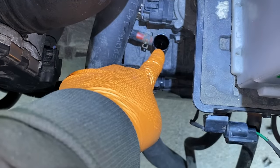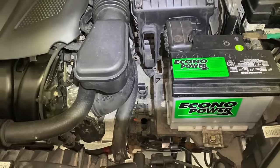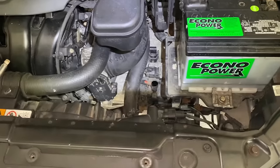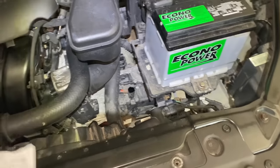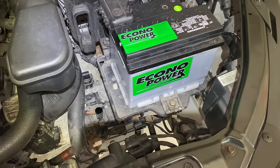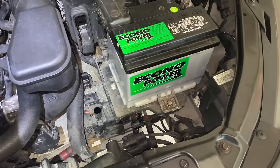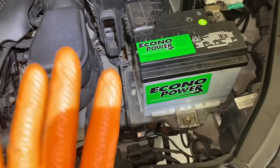You want to get that O-ring before you start this project. Now we're going to put a funnel in here and add the exact amount of transmission fluid we took out — that's the perfect starting point, especially if it was never touched from the factory. Note that your particular transmission may require different fluid. This car — a 2015 Kia Optima — requires Kia Automatic Transmission Fluid SP4. Your car may be different.